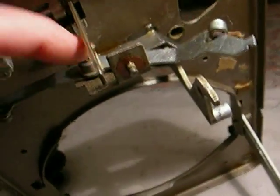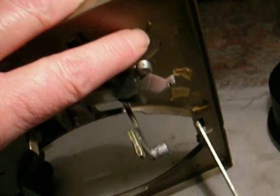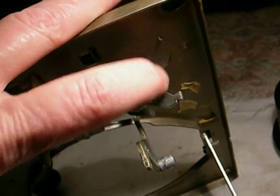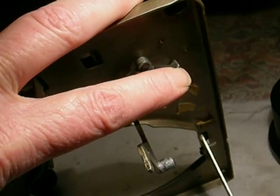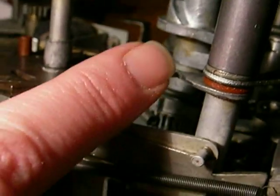This assembly here lifts the arm and it's like a little scissors jack. You have to take out that screw, and there's a spring that hangs from a little permanent loop on the frame on the top panel and goes around that little hook there. Then in the front there's a spring from this bar that hooks down onto the mechanism on this post here, hooking right to this little hook holder right there. That scissors piece has to come completely out as well.